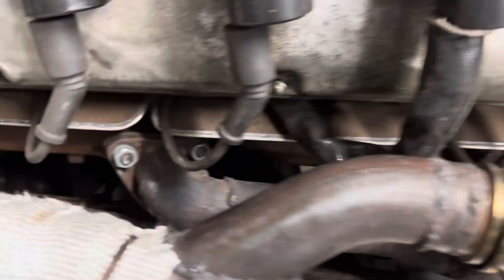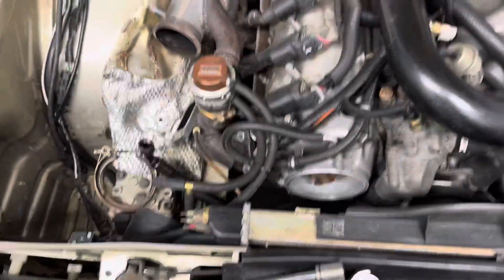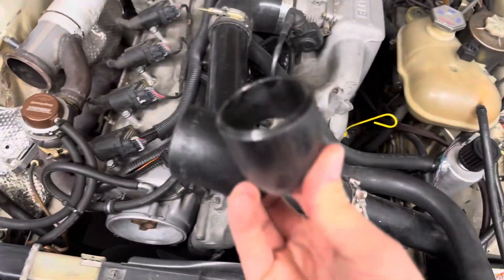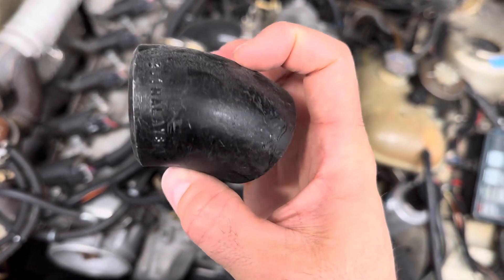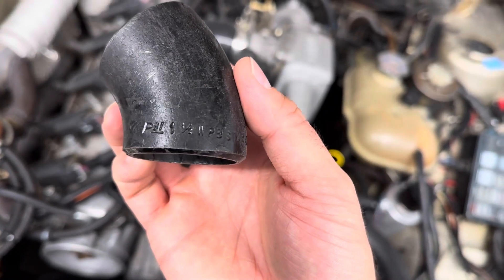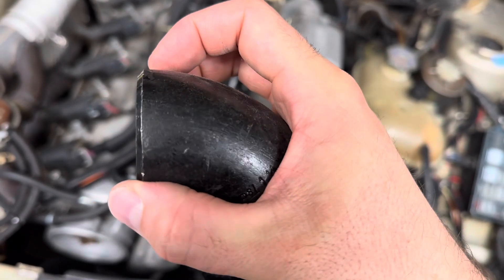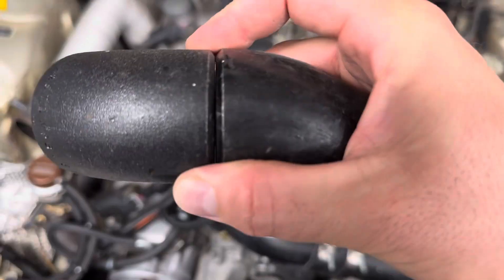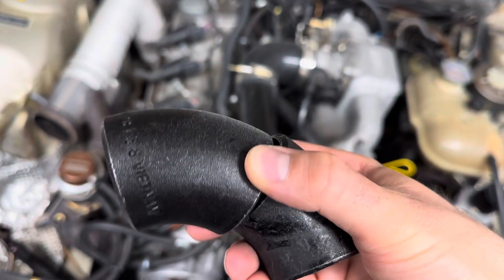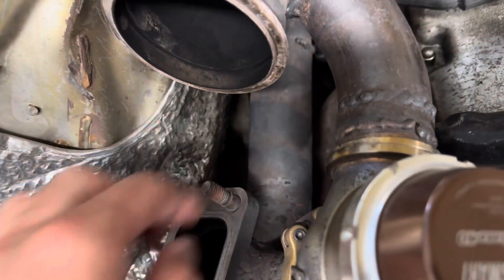I just put fresh gaskets on it between there and cut the manifolds right there. Over on the workbench I have some of the piping — these are weld elbows you get at industrial plumbing supplies. Commercial buildings use this and it gets welded together. They're inch-and-a-half weld elbows that come pre-chamfered and coated in paint, so you need to sand that off before welding, but it already gives you a chamfer so you can root weld them. I used schedule 10 inch-and-a-half piping — you can use schedule 40, but the schedule 10 has held up really well.